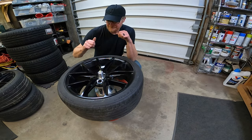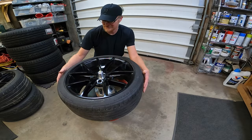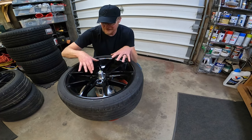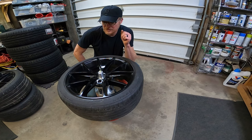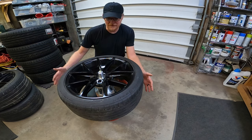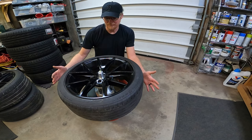This is the wheel for my Cadillac ATS — it's got some old General tires on it that I'm going to replace with new ones, doing it myself right here in the garage. I have a cheap balancer machine from Amazon; all three other tires balanced out dead center, but this one is off a little bit. I'm not surprised because a friend told me there was an 80 mph vibration, so this wheel isn't balanced as well as it should be. First I'll use my homemade bead breaker to get the tires off the rims without scratching them, put the new ones on, and then balance them.